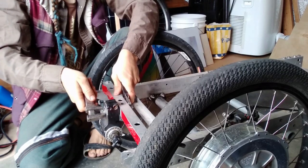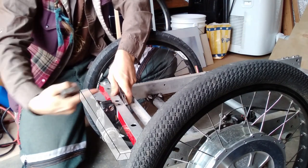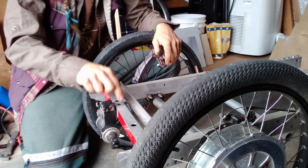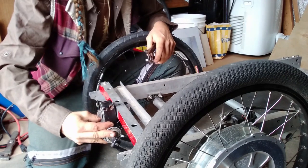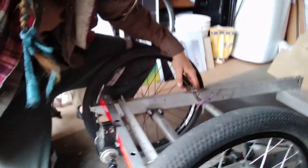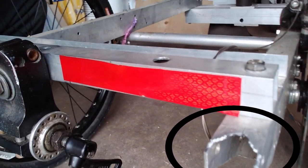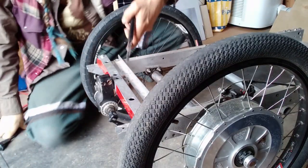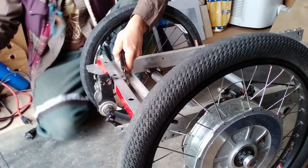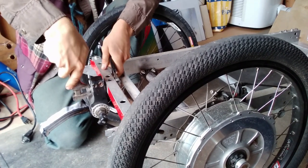If I were to do it again, I would absolutely put a second bar behind this and use a longer bolt going through two crossbars instead of just mounting it to one crossbar, because this was tugging down on just one side of that bar. You can see where the end of that tube is torn out there — that's what happened after about a year of use when this crossbar was bolted at that location. So be careful about attaching the entire weight of another trike cantilevered off the back of something.